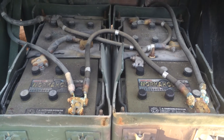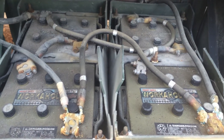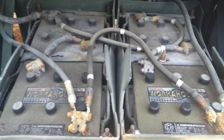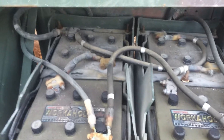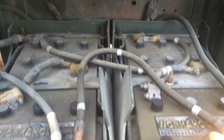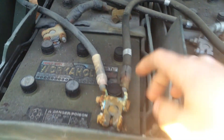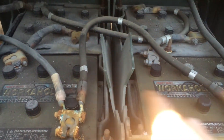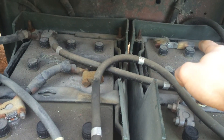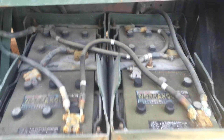If you wanted to use only two batteries instead of four, you could eliminate this line completely, eliminate the far right set, and just connect this positive line directly here. There's a positive line connecting the two sides in parallel, connected in parallel via that negative line, and then back to the truck on either side. Thanks a bunch.